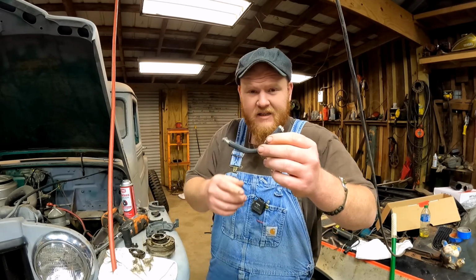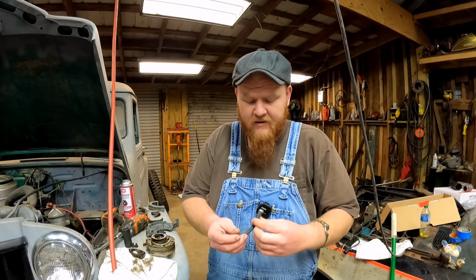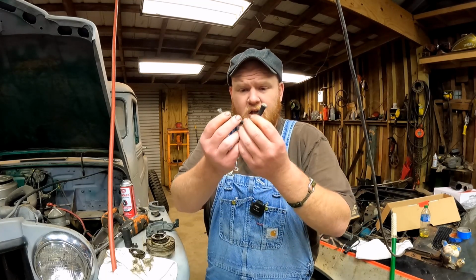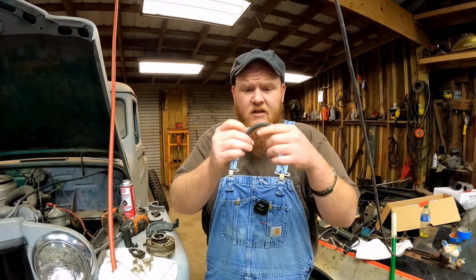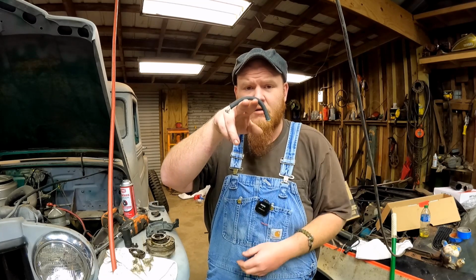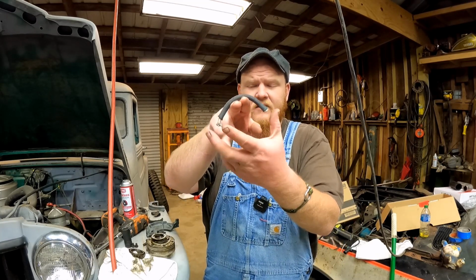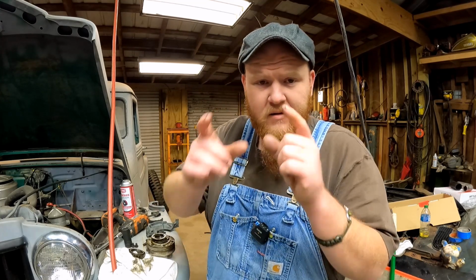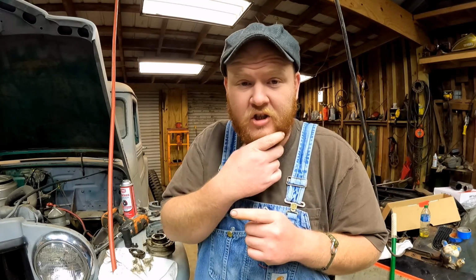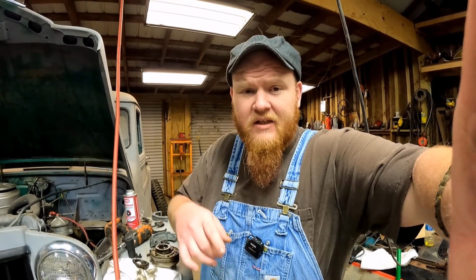This is the rope rear main seal, okay? This is just BS. But anyway, they did this on a lot of older engines. So on that bearing cap, you'll have this half on one side, the other half is in the engine block, and that shrouds your bearing. Your crank goes in the middle like this, and the other half goes like that. Normally, you have to pull the bearing cap out, be very careful not to sling your bearing on the ground, and you'll have to fight the rear main seal out of the engine block.